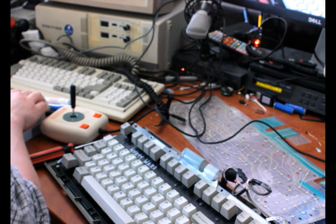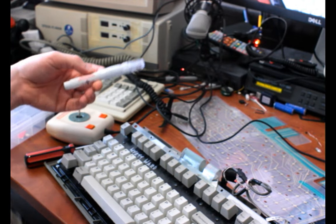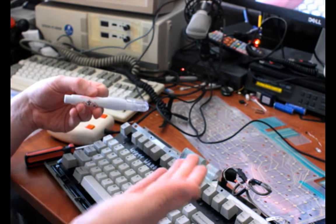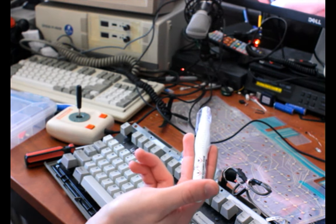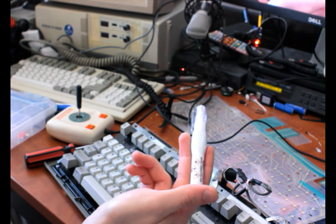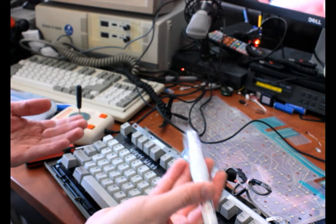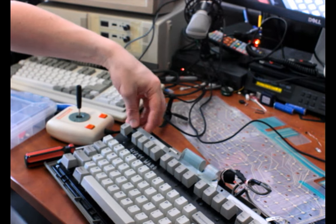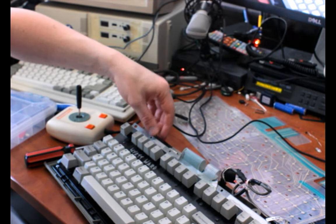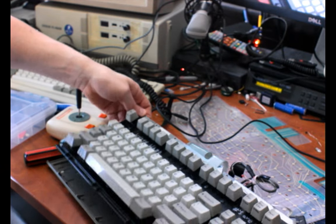the conductive pen works, but I was noticing that every time I took this thing apart again, the traces were breaking again. I'm guessing that's just because this flakes off. It's not really meant to flex much. But if it cured in its correct curled position, then it's fine until it gets flexed again. Anyway, I got sick and tired of it after dealing with this for months, maybe longer.